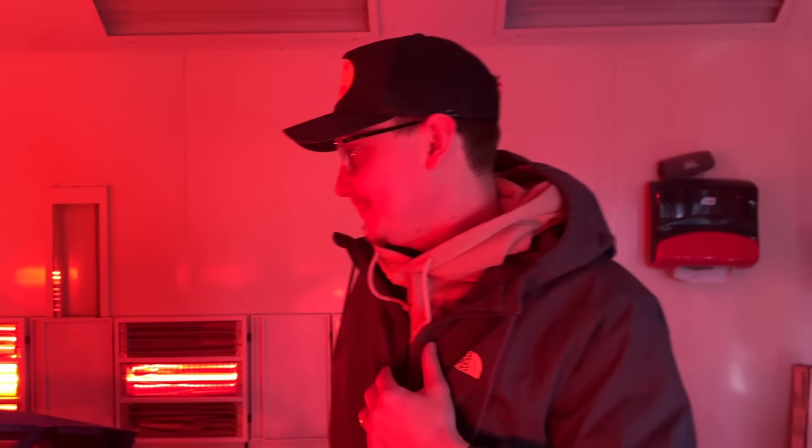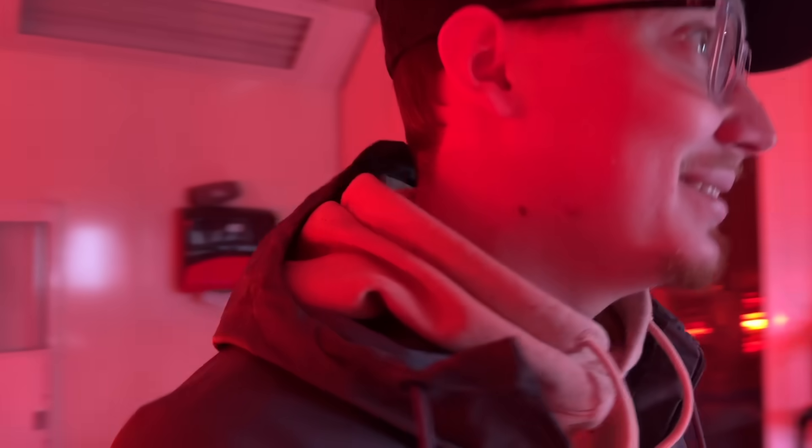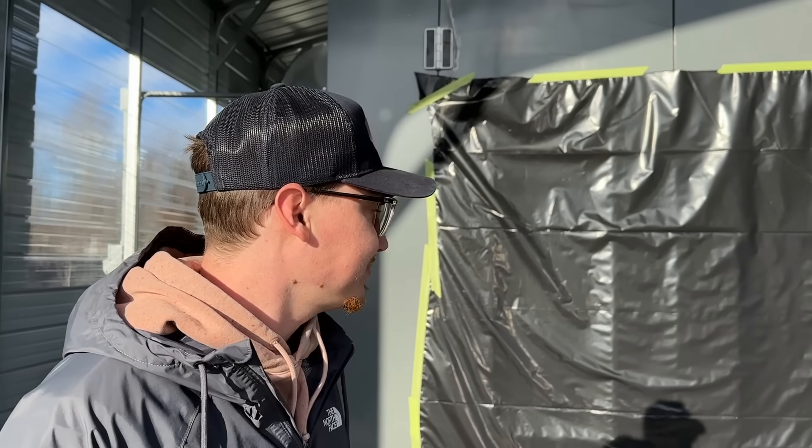It is powerful up in here. The curing lights are really making some off-gas — not good to smell this stuff. But it turned out perfect. There was a little issue — we got a fast reducer for the clear coat so it was drying really weird during painting, so I painted it as fast as I could. But I think it turned out great. That stuff is going to look so good once we cool it out in the sun.